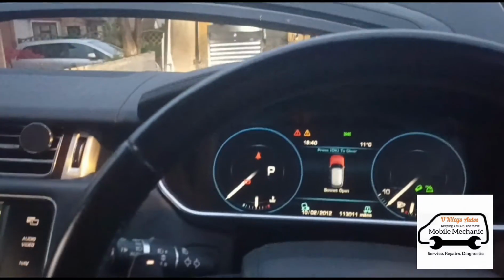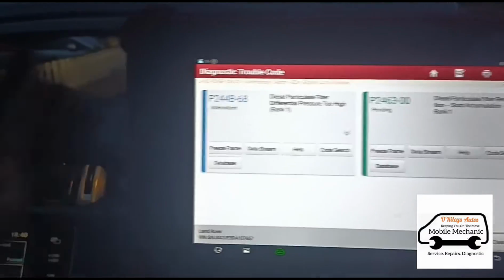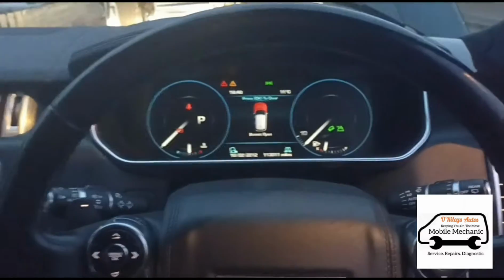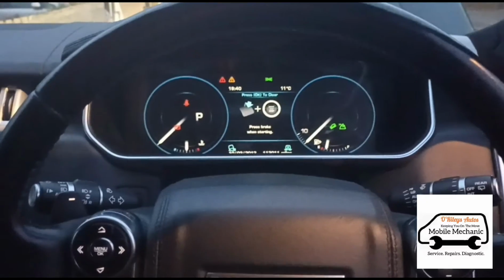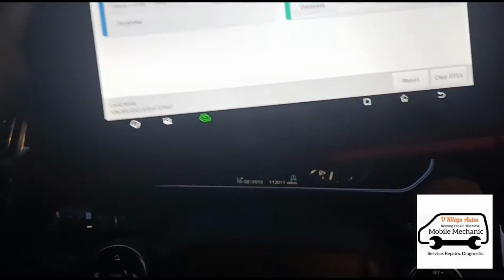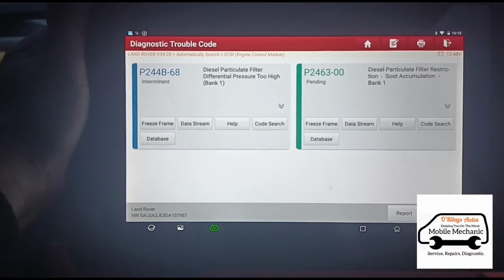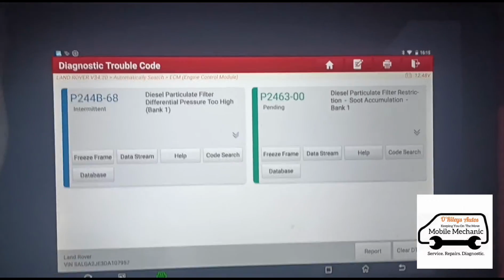What's happened is he's had this at a quick fix service centre, and shortly after he's had a service, engine management lights came on. He's had the AA out to look at it, and it's been overfilled with oil. The AA has drained out the oil to the right level, but it has caused the DPF to get blocked up. So just getting the car raised up.